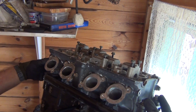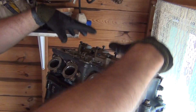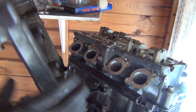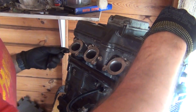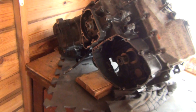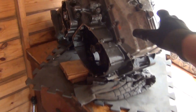So I've got the cylinders on, I've got the head on, secured by those four head bolts — they're just snug, there's no valves, no pistons, nothing. I'm going to have to put two cam holders on as well, because the valve cover actually secures to the cam holders. Now I'm going to put the valve cover on and secure it by just a few bolts. There we go — the engine is upside down, and I can work on it fairly easily now. I hope it now makes sense why I put this head and cylinders back on. I've got some soft padding underneath so I'm not damaging the paint, and it's actually somewhat stable.